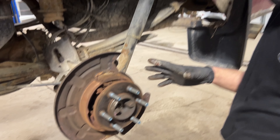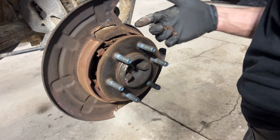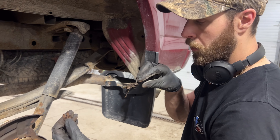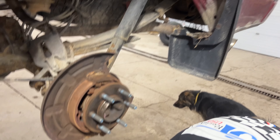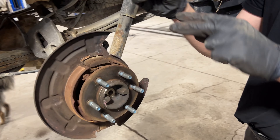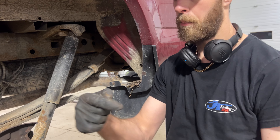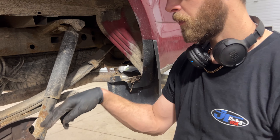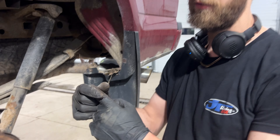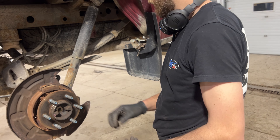Got it off — took a lot of beating, but it did pull the pins out through the back. What happens is I'm going to put pins back in. These clips are nice because you can just stick the pin in and slip them up. There are different styles where you have to push it on a spring and turn them — a pain — but I'm just going to reuse these. The issue is the backing plate metal where the hole is has gotten the pin pulled through, so it mushrooms out the hole. When you go to put a new pin in, it's probably just going to get pulled through again. Two things you can do: remove the shoes and try to flatten the backing plate back out, or stick a washer behind it on the pin first so it can't come through. Emergency brakes work fine afterwards.